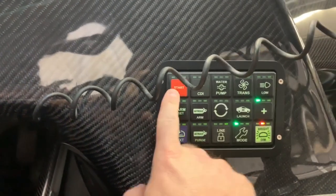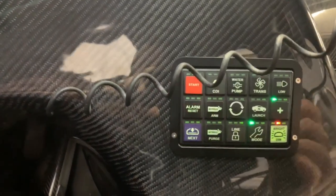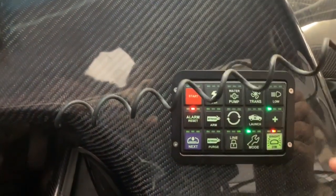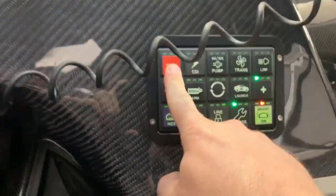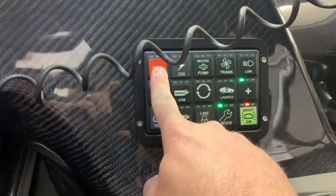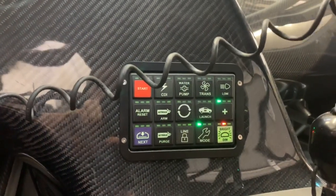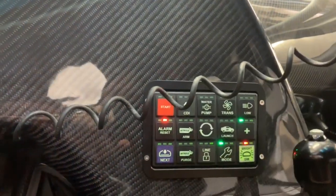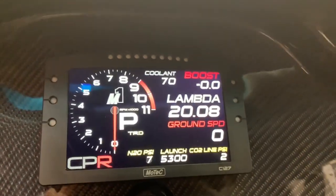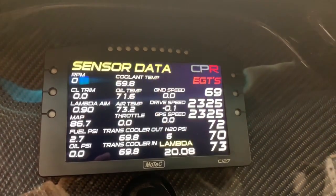I could push the starter and get action in neutral, but as soon as I put it in reverse that system won't work anymore — same thing with first. They'll check that when you go through tech. If the gear position sensor fails, I wanted something in play so I could still start the car in the staging lanes — so I made it so if you hold this button down for five seconds it will fire off the starter. There is an override, but you really have to hold it for a while before it'll fire.